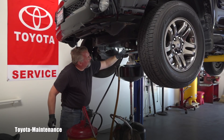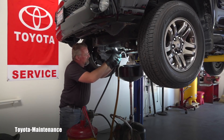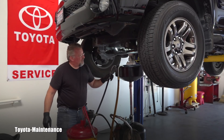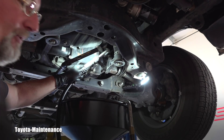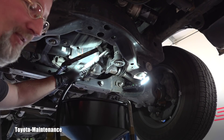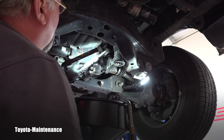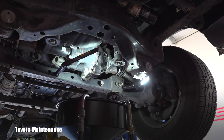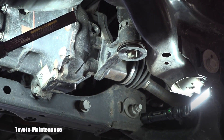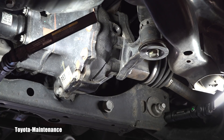The meter is at two pints — I'll take the pump out. You'll need a pump because the bottle won't fit in the filler hole if you're trying to do it yourself. At 1.2 quarts, sure enough, I just reached the level perfectly — you can see it running out. This is just perfect; if I put one more pump it would just overflow. We are confirming that the owner's manual spec of 1.2 quarts is correct.